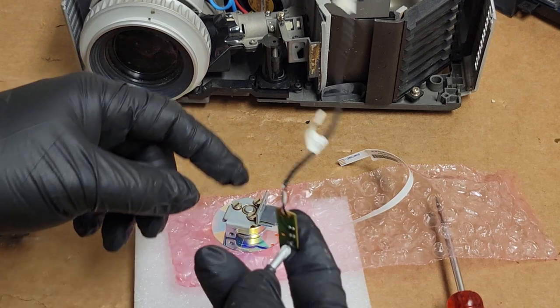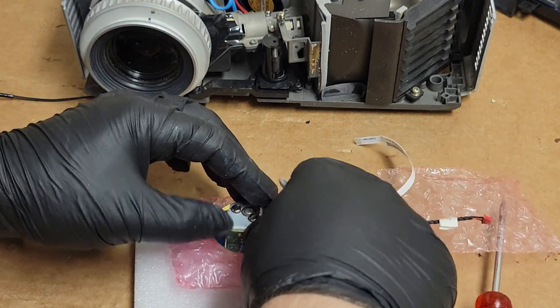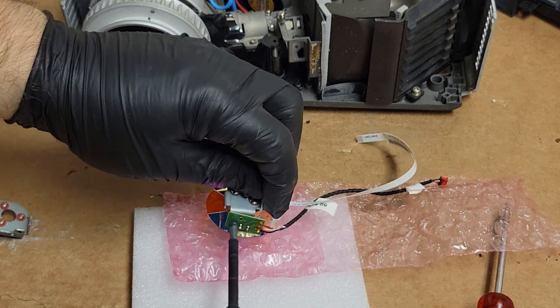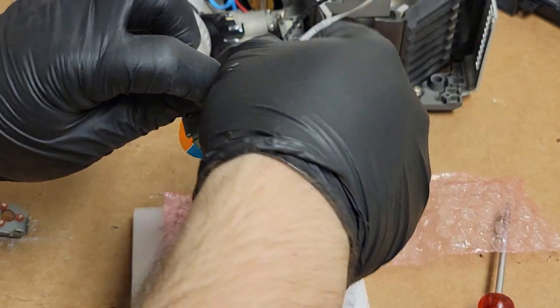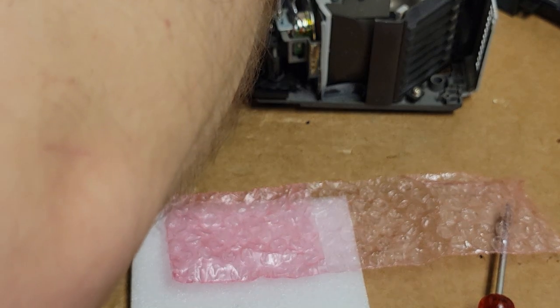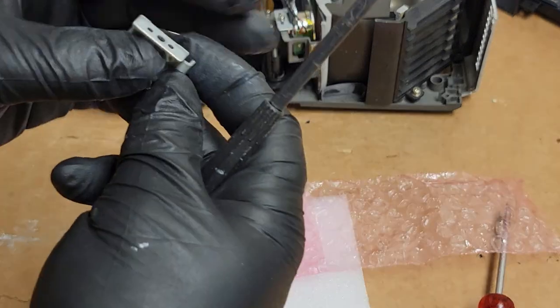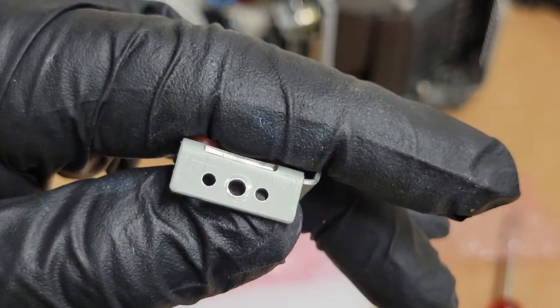That looks good. Oops. Sits there. That must be why the part number isn't the same as what's on the label. Because it comes with that bracket, maybe? I don't know. It's definitely a new bracket, though, because there's no mark on it from the screw being tightened. Most of you probably know this, but you can see if something's been installed before, because there'll be some sort of witness mark on the metal from the old screw being on it, which was the case here.